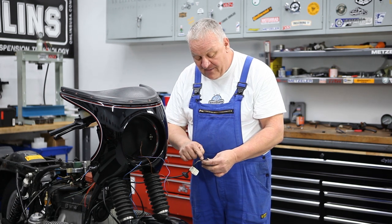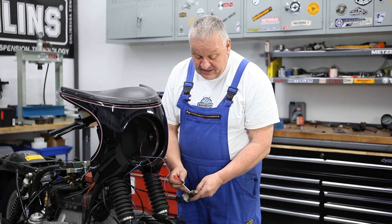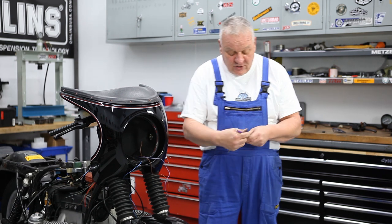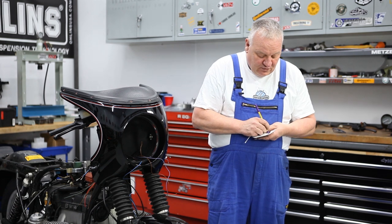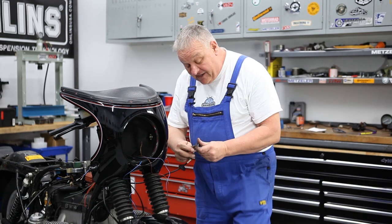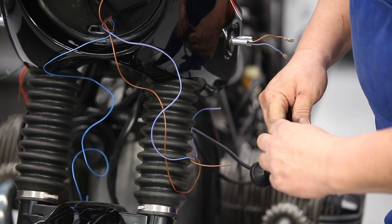In order to get this apart without destroying the grommet I'm just going to pop the connectors out — that's really easy to do. You want to note how this comes apart, so I'm making a little notation on a piece of paper: brown, yellow, white. You'll need a small flat blade screwdriver, and then you can go into these connectors and slip it right inside this little notch.